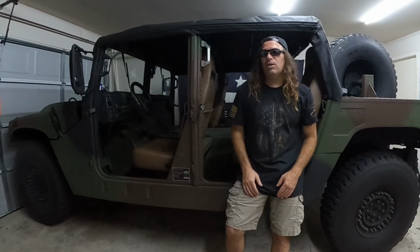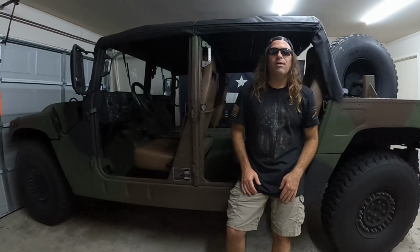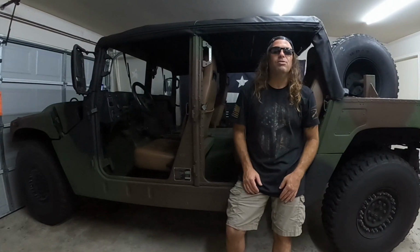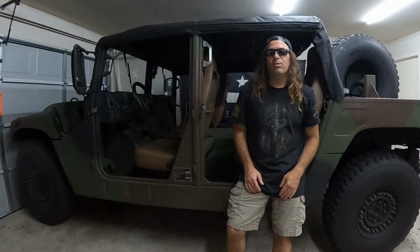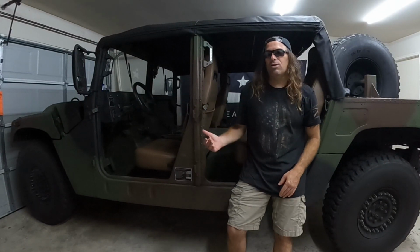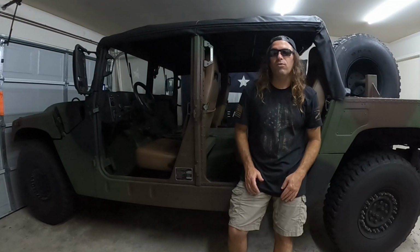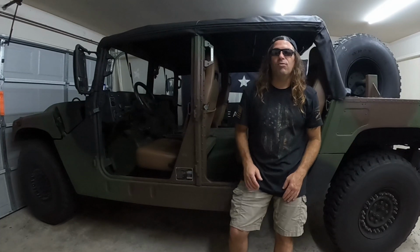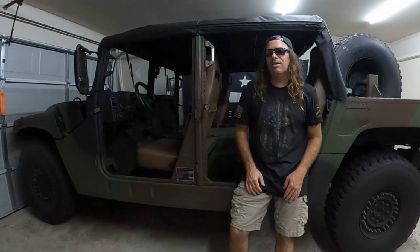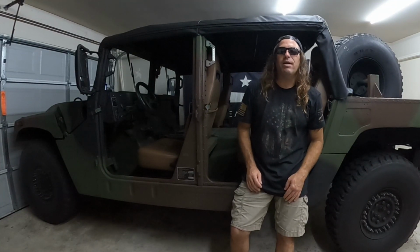So, no subs, nothing really nuts like that, but I am going to try to build something in here that's going to have a reasonable output that can actually be heard at a reasonable volume with the doors off going down the street. So obviously we'll be dealing with an amplifier and a head unit. But of course the big trick with these is with the truck being 24 volt, and as far as I know there's no audio equipment out there that's designed for a 24 volt system. We're going to be trying to utilize 12 volt. So the 12 volt charging side on these trucks isn't huge, but I think it's adequate enough to be able to do something with a minor amplifier, so long as we're not drawing a massive amount of current.